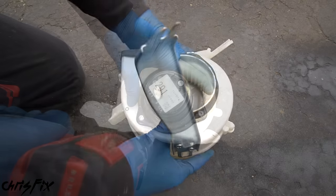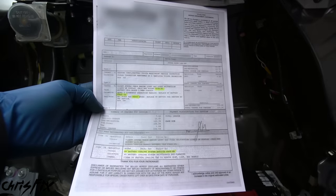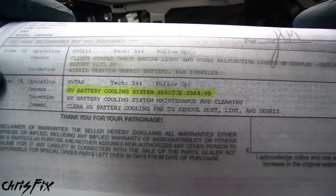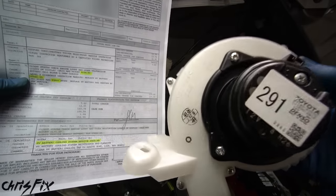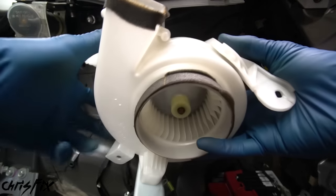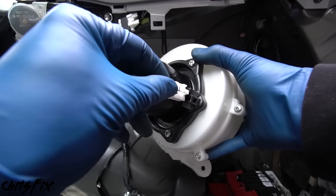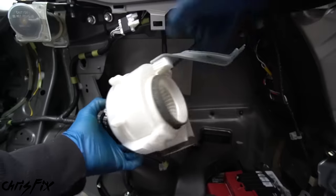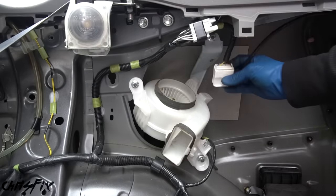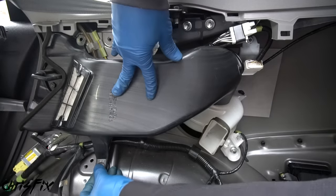Remove the fan to clean it by removing these three bolts. Turn the fan around, push the wiring harness clip to release it, and disconnect the electrical connector from the fan motor. You can clean the fan with a pipe cleaner doing each individual blade, but it's way easier to unscrew the five screws holding the cover on, separate the cover for direct access to the fan, and blast the fan blades with compressed air. Finish with some soapy water and dry with a towel — that removes all the dust and lint. Reinstall the five screws, plug in the connector, tighten the three bolts, mount the wiring harness, and reinstall the intake duct.